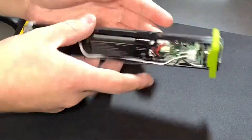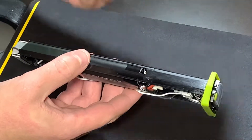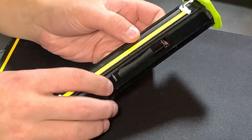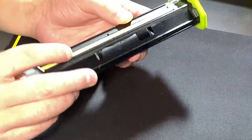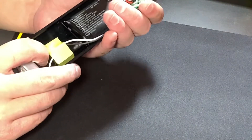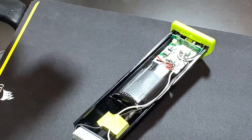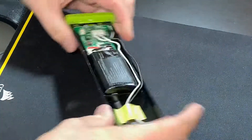All of that is mounted to just a plastic tray inside the metal tube, so it's obviously heavy enough as it is — really nice and weighty in the hand. It would have been nice if they had made this tray out of metal, because then it would have had some heat sinking for the COB on the back. I don't really know if it's going to overheat on high power mode — it's on plastic the whole time. The LED up front, which is the spotlight, has a little bit of heat sinking to it, and it's pretty bright, so it must need some.